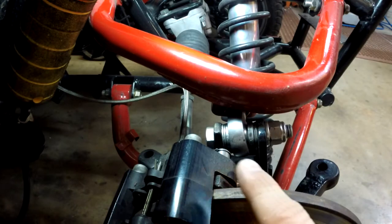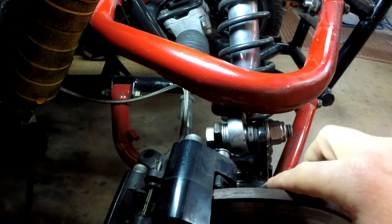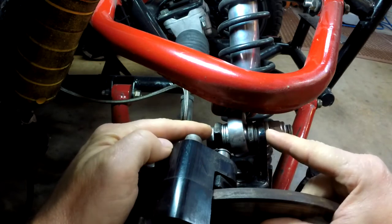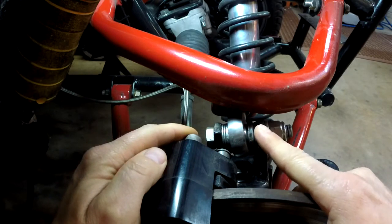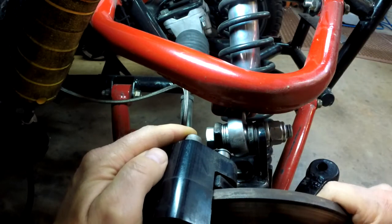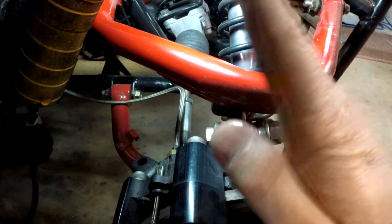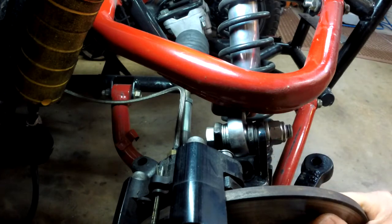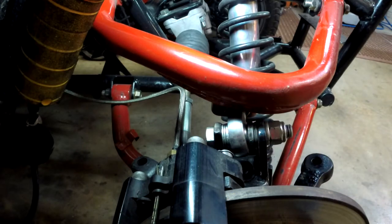On the other side, here's my heim joint coming in on the top A-arm, and here's the top of the spindle. I made these two mounts wider so I can stack washers in there. You can take washers from one side and put them on the other to adjust your caster angle. I found that the EasyGo sitting on the ground is about 10 degrees caster back, and leaving it at 10 degrees works very well.